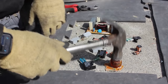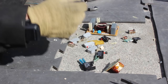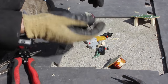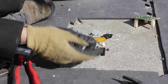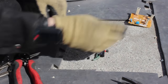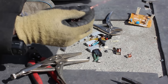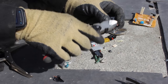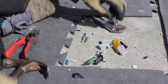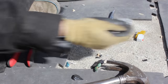Now these things are a ferrite bead encased in plastic with a bunch of copper winding around them. You can give them a solid whack, it breaks the bead, and generally you can just twist it off from there. Now it's possible you'd make more money if you just left this onto the heavy ferrite bead and brought it in with your bucket of motors — that's up to you. Now these little black things that cracked off of the button panel have a couple different things you might be interested in. The first thing you'll find is one of these, which are really quite easy to separate with a pair of pliers, and then you can just start peeling all of the copper off. That little button is an alloy of tungsten and silver, so you may want to save those. And finally, all these little switches — if you crack one open, you'll find they also have copper leads with little buttons of silver-tungsten alloy. So they're worth cracking apart.